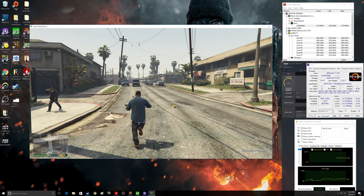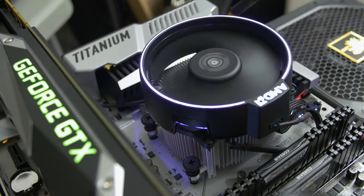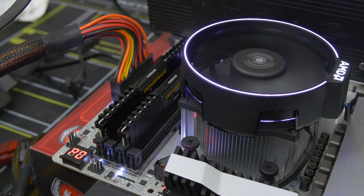Now let's see how it performs when we crank things up on the multiplier. I got the chip stable at 3.9 GHz at 1.3 volts — CPU-Z was reading it a little higher at 1.312, but very consistent on the Vcore. I fired up GTA V again with all the same settings and saw the core temps start to spike, climbing up. Once they hit about 80 degrees Celsius, I rebooted into the BIOS and cranked the Spire fan up to 100%. Before you start thinking it's going to sound like a turbine engine, it actually doesn't — the Spire fan is incredibly quiet, even at 100% fan speed. I had my window AC unit running and I literally had to put my ear to the cooler to make sure it was spinning up, because it was just being drowned out by the AC unit. So especially if you're using headphones while gaming, you're really not going to notice the Wraith spinning up to 100% at all, especially inside a conventional closed chassis.